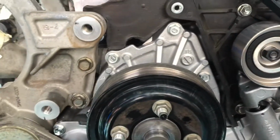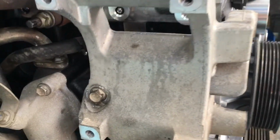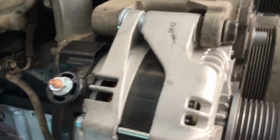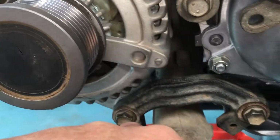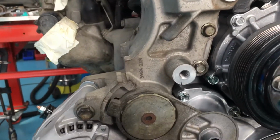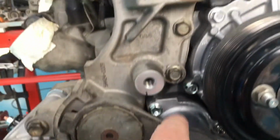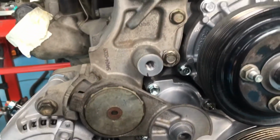So once you've got all those bolts in, this main drive belt tensioner assembly is what goes back on. You've got that bolt there that you can see, and there's another one behind the alternator, and we've put the alternator back on. There's one main bolt through the top, and you've got the bracket at the bottom with the one main bolt at the bottom down here, okay? So the tensioner's on, the alternator's on. There's three bolts in the front, as you can see, 1, 2, 3, the two that went through the water pump. So that's that side pretty well done.